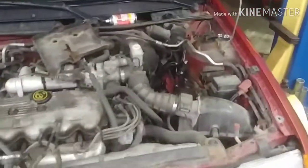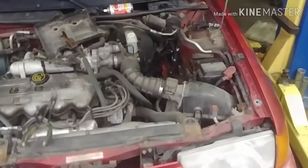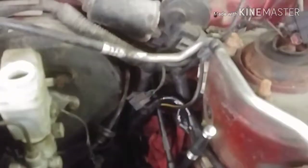Bam. Hey guys. 1996 Ford Escort 1.9 liter single cam 5-speed manual transmission. We just had a cold stint of negative 20-degree temperatures for about 3 days in northwest Indiana. And as soon as it started to get cold, he started to lose his pedal on his clutch. So that leads me to believe that his master had died.